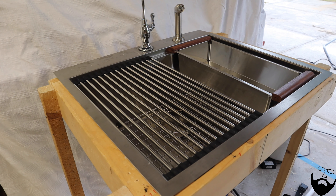I did make a change to the reverse osmosis water system. When water goes through the reverse osmosis process, it's going to lose some water — for every gallon you gain in purified water, you might lose a gallon or gallon and a half to wastewater. You may not be able to do that when traveling in your van. But if you get water off the side of the road, off a creek or someplace where you're not sure about the quality, you would want to put it through this reverse osmosis system. Most of the time I'm going to be getting water from a municipal hose or a friend or family's hose. Then I can send it through just the filters and the UV sterilizer without the reverse osmosis system, and that way I'll maintain 100% of the water in my tanks.